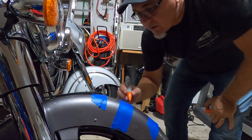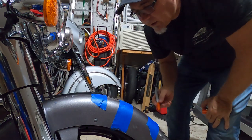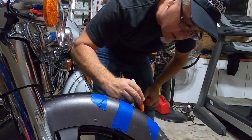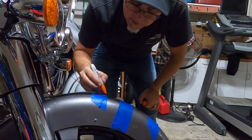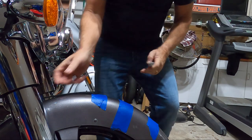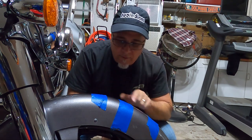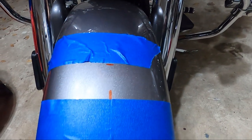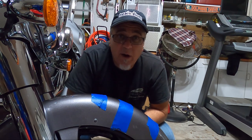So I'm just going to make a little line here and a little line there. On the front, this is the front edge of that rubber grommet, so I'm just going to put a little mark here that I know will overlap, and then the same on the back. So I know when I put this rubber piece on here it's going to cover that up. Now that I've got the front and back position and dead center marked on the fender, we're going to pull the fender off and get it set up on a bench so it doesn't rock around when we try to drill the holes.